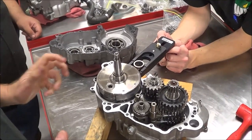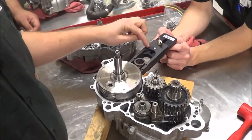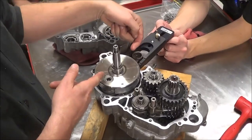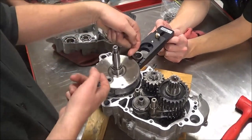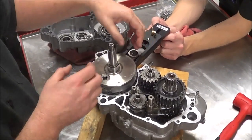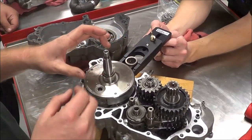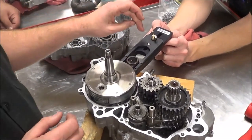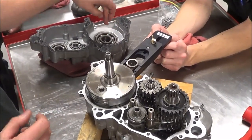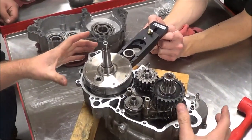We're getting ready to assemble our cases on the KX250. You can see we have our crankshaft support in here. What you do is put the rod all the way down, opposite the crank pin. These have a bunch of wedges that you wedge in, lock your lock nut down, and support it so as we're pressing it together that prevents the crank from going off. Normally I heat up the bearing so it just slips on without pressing.